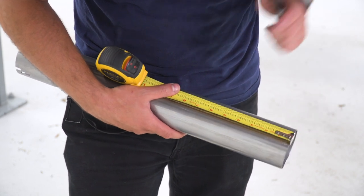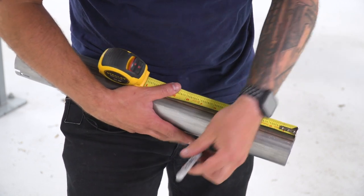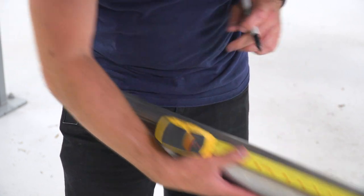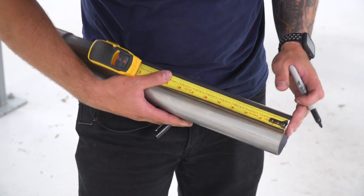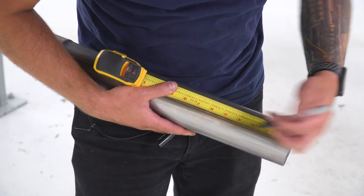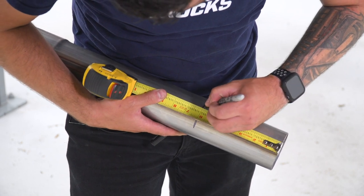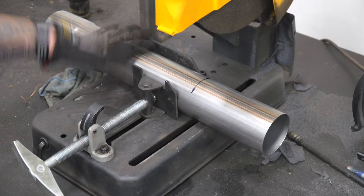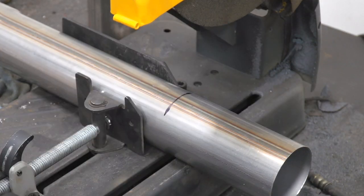If you have a SuperCrew with a 6.5-foot bed like we do, we have to cut 6 inches off of this pipe to get it to fit. With my tape measure, this is the part that connects to the pipe and this is the part we need to cut. I'm measuring 6 inches up and marking it on each side so I know exactly where to cut. Let's head over to the saw. I've got my 6-inch mark still good — make sure you're measuring twice and cutting once. You don't really get a do-over here.